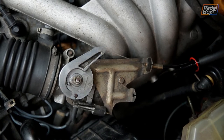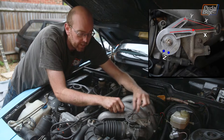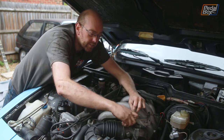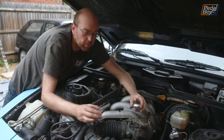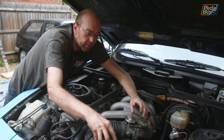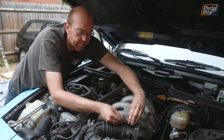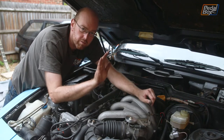This eccentric cam that sits on here at the moment results in a fairly big movement actually producing very little throttle actuation, because of this much longer piece that comes off and is the first part to be pulled. This is a completely circular pulley, which makes the throttle actuation completely linear. To take this off, we pull this around and take it out from the index. The nut comes off, and this just pulls off. There's an indexing point so it goes back on in the same way, and the nut goes back on top. Once tightened up, this just spins back around — you can already tell, without the big actuator on the end, how much stiffer it is to pull. There's no lever effect. So that is now a completely linear throttle, giving much better throttle response from just touching the pedal.